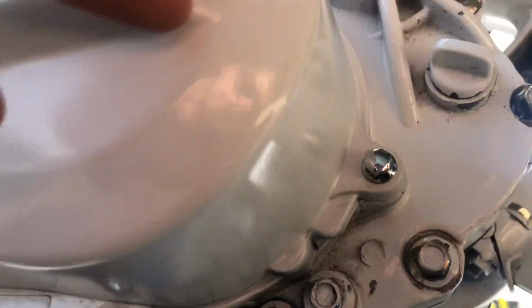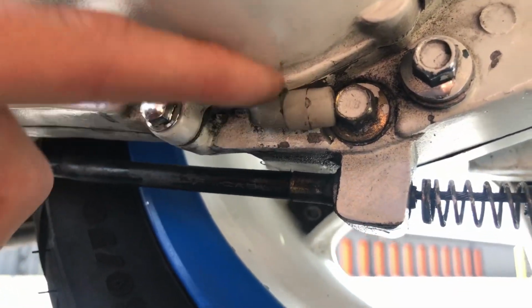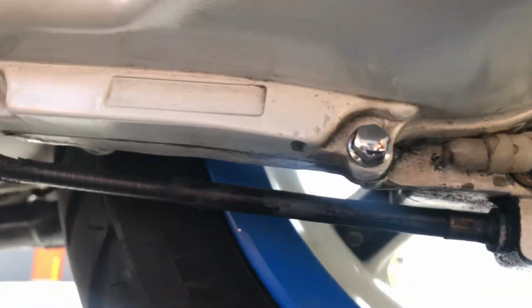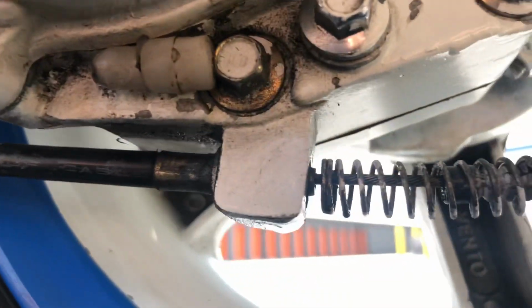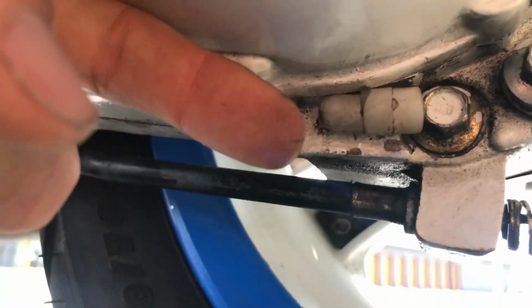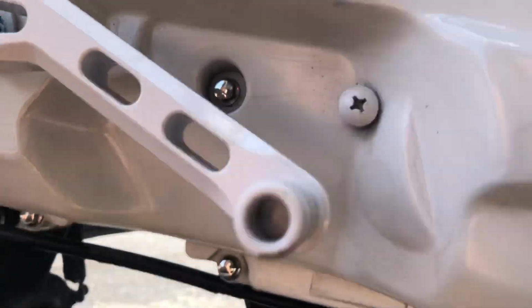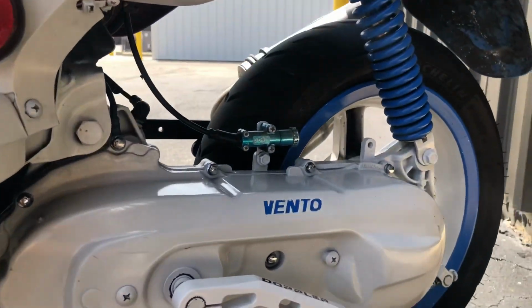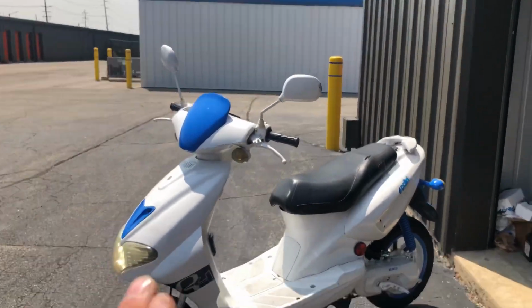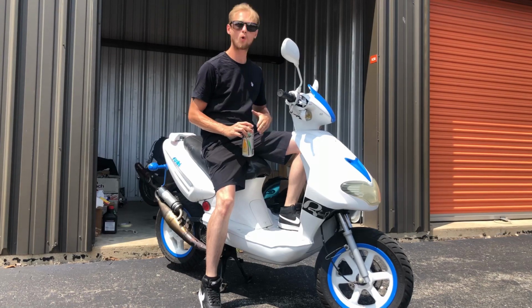When I was banging out my gearbox trying to get the bearing and shaft out and stuff, I must have banged this out with it, because you guys remember that hole that existed. But we got one. We took this off of an old motor that was sitting around, and it fit right into place. And as you see, if I take my finger here, nothing. So 2 things. That gasket and that plug came together and fixed the problems that we had on this bike, because she starts, runs, and rips with no oil. Fantastic. So the gears are installed, there is no oil leak.